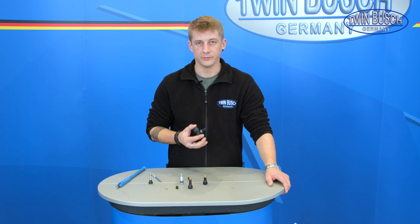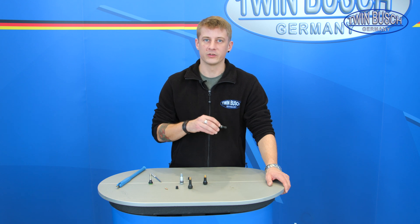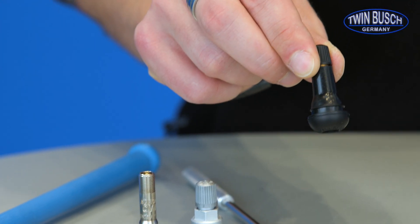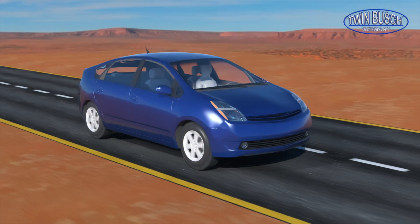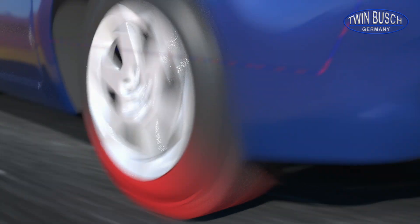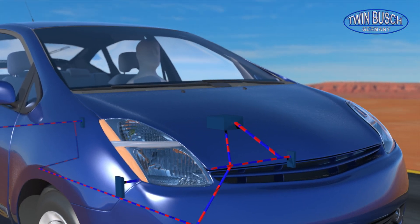Let's talk about valves with tyre pressure sensors. Tyre pressure sensors have been a requirement for newly registered vehicles since 2014. Direct and indirect systems are permitted. No special sensor system is needed for indirect measuring systems — just a normal valve. The measuring system works via the ABS system or partly traction control. When a tyre loses pressure, the tyre's circumference decreases and its rolling speed becomes greater than the opposite side. The ABS sensors detect the speed difference and report the error to the onboard computer, alerting the driver to a loss of pressure, though without specific amount or details.